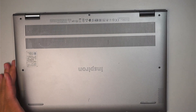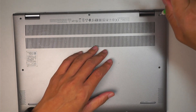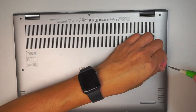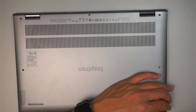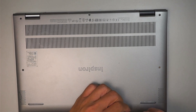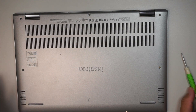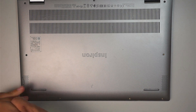Let's go ahead and get started. I'll be using a Phillips screwdriver — this is the 1.5 millimeter. We need to remove the screws here in the back to get into the laptop. Keep that in mind: the screw on the top right corner doesn't come off. When you unscrew it and you hear that little clicking sound, you should stop at that point. There are 4 screws here at the bottom — remove all 4 screws.